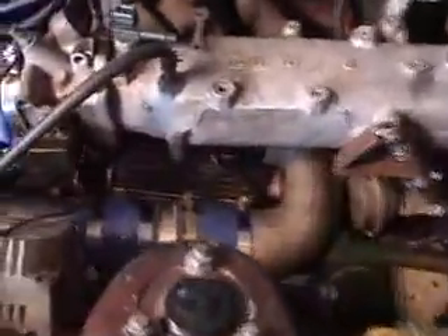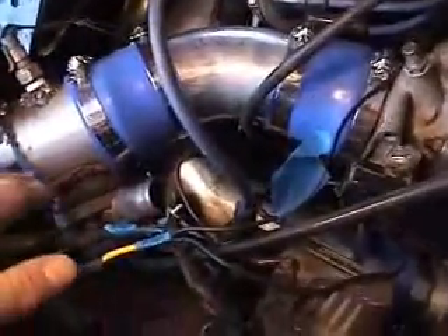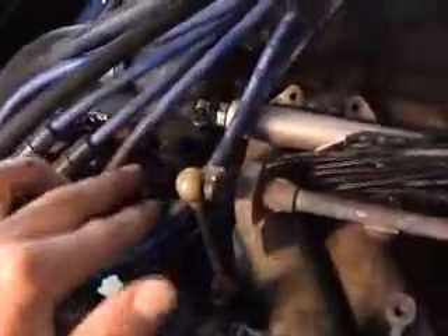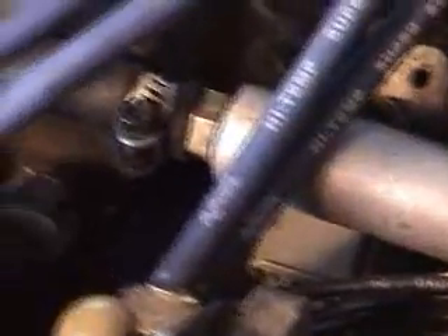Alright, I still need to put all the wiring away, but I have now lost the air flow meter on the turbo, thanks to MegaSquirt. So I got the whole setup: turbo on the piping with the blow-off valve. I put my GM intake air temperature sensor right before the throttle body, and then I drilled and tapped my thermostat housing for the GM coolant temp sensor right there.